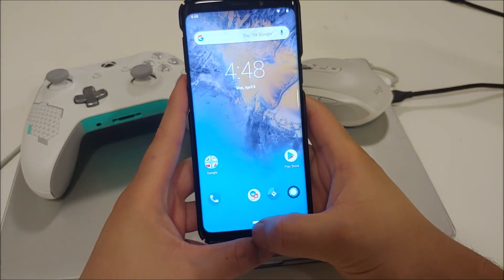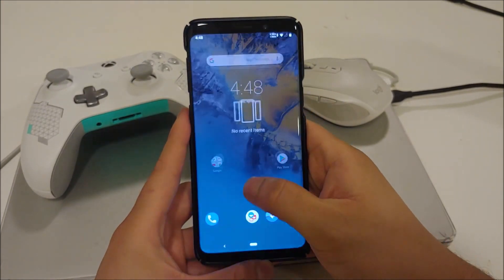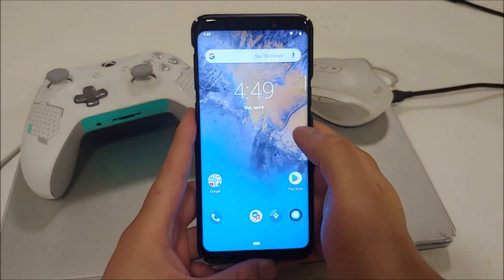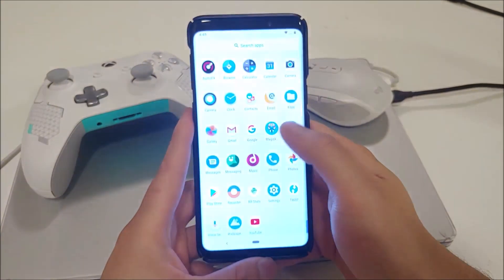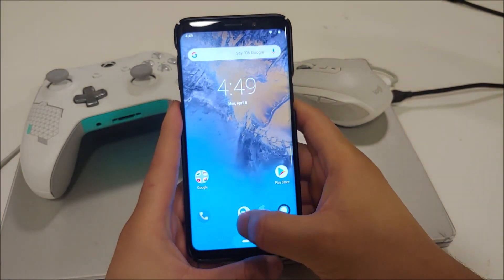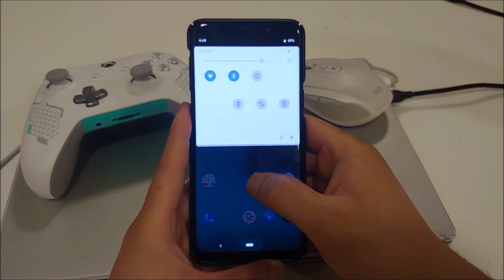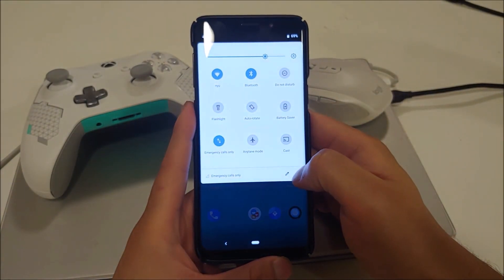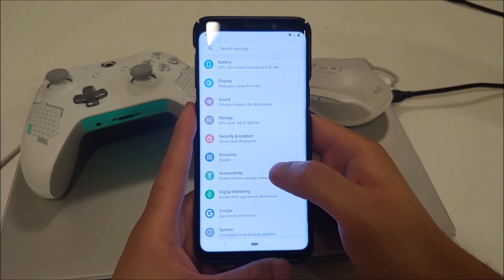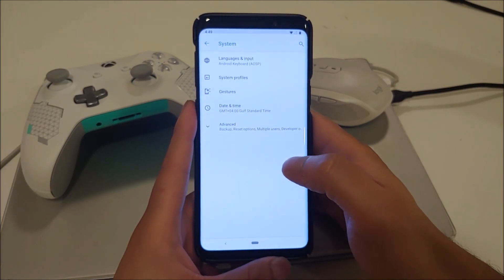As you can see, this is clearly Android 9.0 Pie. I'm using these gestures just to show you it is indeed Android 9.0 — not out of any love for them, as many people prefer the navigation bar. That's the Google Now feed and the app drawer. The ROM comes pre-installed with two launchers: Trebuchet and Pixel Launcher. However, only Trebuchet is compatible with these swipe gestures; Pixel Launcher is not. For Android 9.0 gestures, make Trebuchet your default or get another compatible launcher, possibly via a Magisk mod.